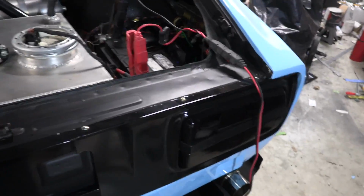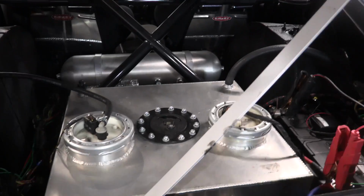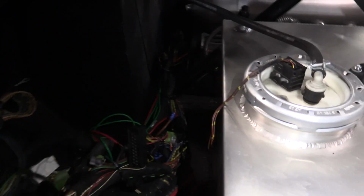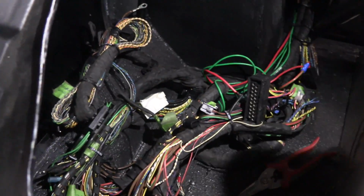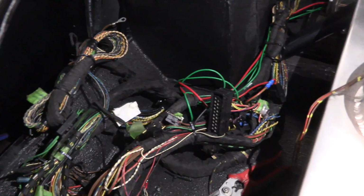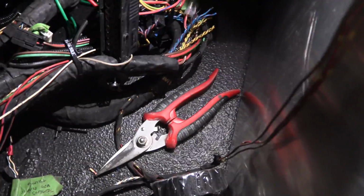Because we have both the left and the right speed sensors are both off. So I don't think it's just one weird wiring fault, because if you guys remember, the loom kind of goes all the way that way and then around and all the way back up. So they're basically independent of each other. Then they're not on the same path through. So I'm gonna go ahead and plug in all the computers and just by hand, trace the wire through and make sure that it's not deadheaded. Like, here's some matching wires that are deadheaded, but those are for the speaker system, so it gets a little complicated.